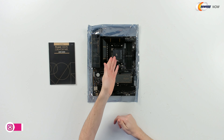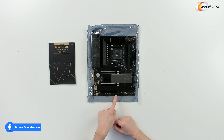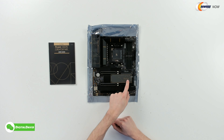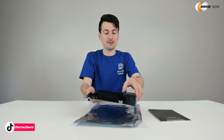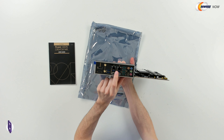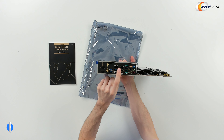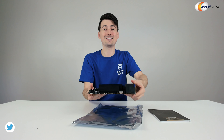Here's the board up close. You can see where the CPU is gonna go, our memory, USB Type-C right here. We have one USB 3.0 and three USB 2.0 options. Three M.2 drive mounts as well, all PCIe 4.0. Look at the really cool ProArt logo and branding sprinkled all throughout. I love the color scheme with the shields and our heat sinks. Now let's look at it from the side — you can see all of our I/O: audio, BIOS flashback, all our USB ports and USB Type-C, Thunderbolt 4, DisplayPort in for Thunderbolt 4, 10 gig networking and 2.5 gig, and our Wi-Fi 6E antenna mounts.